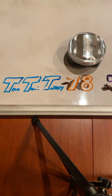So then you buy a lockup or a Barnett or some kind of Scorpion or something that makes your clutch not slip anymore. And when you do that, now you're going to break something because the clutch is a fuse. You need the clutch to slip a little bit. So if you fix the clutch where it won't slip, then there's a chance that you're going to break some parts. Now back to the compensator deal.